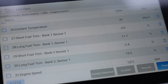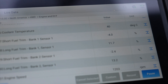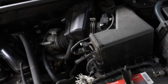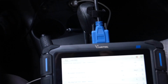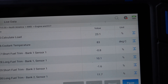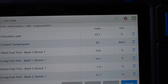You don't need the check engine light to come on if you're chasing the P0171 — just look at the fuel trims. We're at plus 13 in the long term; it used to be 20, so we're definitely heading in the right direction. I went under the hood and actually routed a couple of hoses incorrectly, which is probably why it was still plus 13. After driving the car for about 10 minutes with the hoses in the right spot, we have a long-term fuel trim of 10. Ten is okay on an older Toyota, but you want to see something more like five or zero. Either way, 10 is totally acceptable and the check engine light is not going to come back on.